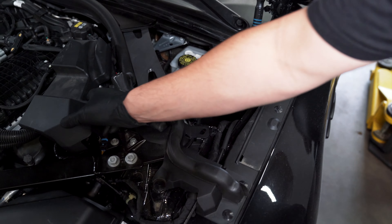Right here is the split of the three wires. You have one wire going here to your map sensor via this rainbow-colored wiring harness — this is going to tuck back down and kind of hide out of the way. You have the original connector here plugging into the JB4 harness, and then the JB4 harness itself plugging into the map sensor. That routes down the side of the intercooler here into this tri-split. The wiring harness splits into three looms right here, kind of behind this coolant pipe. You have this smallest loom which is routed down to your T-map sensor below your auxiliary coolant water pump.